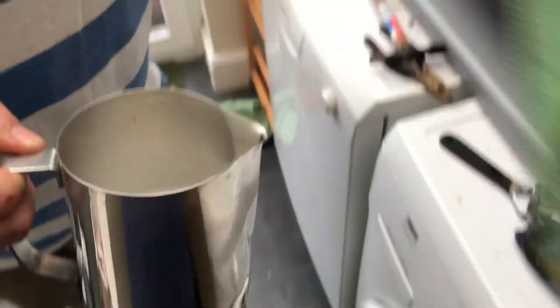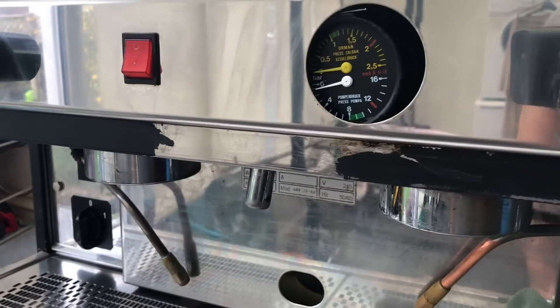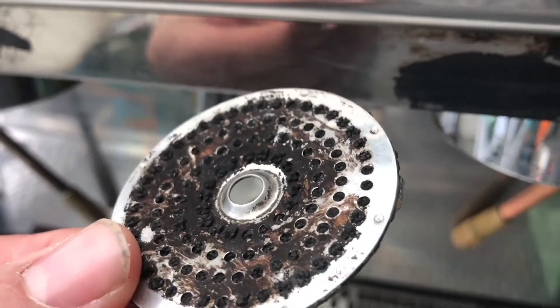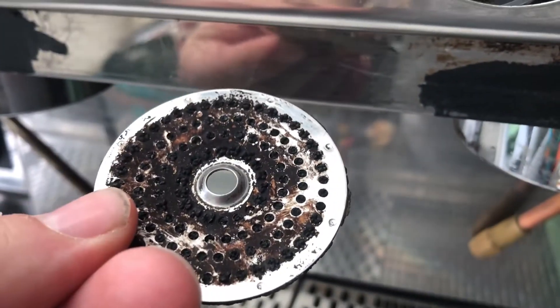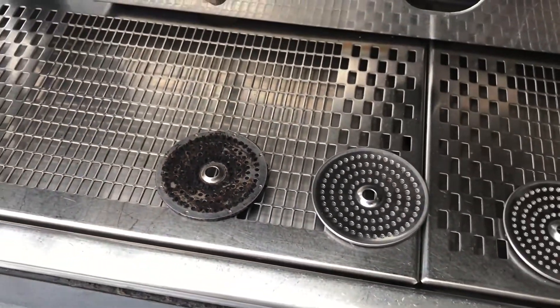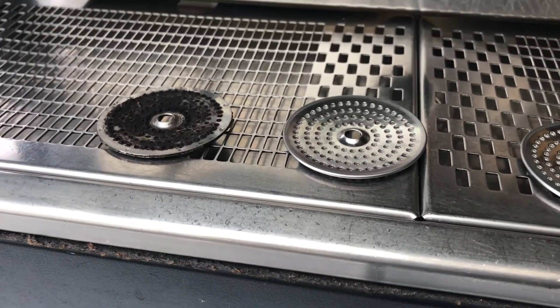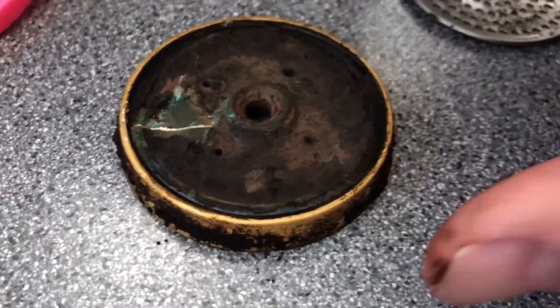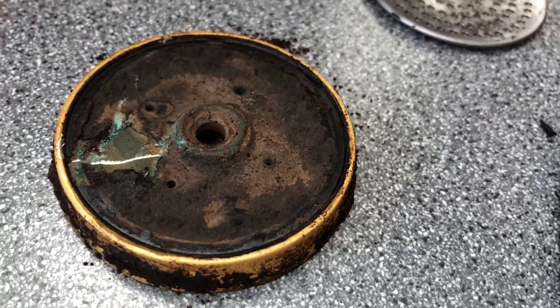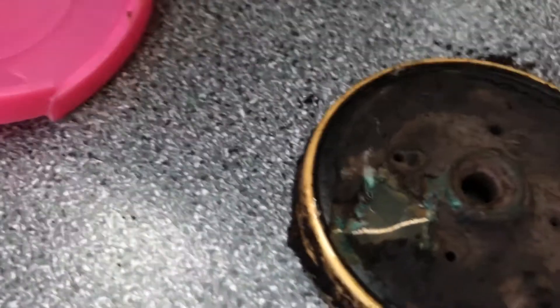So in terms of the water flow and the operation of the machine, it was OK, actually going OK. It was just the actual state of it. So if you look under here now, we're going to go underneath. Look at them — dented, bashed, broken dispersion plate, shower screen, all just absolutely had it. Now, that's the shower screen I took off the left-hand group head. Just look at that. That's what you see on the outside, but that's the inside of it. I couldn't even tell you the last time it was cleaned. That's an old one. That's the new ones we ordered. Just look at the difference. It's just incredible. And the entire refurb to get the new shower screens and bits and pieces that we needed was only about 10 pounds. That's the dispersion plate — just look at the state of that. All that is just ground coffee. Just horrendous.